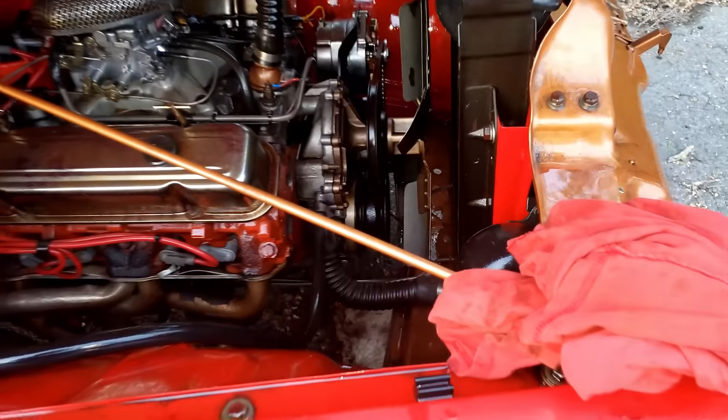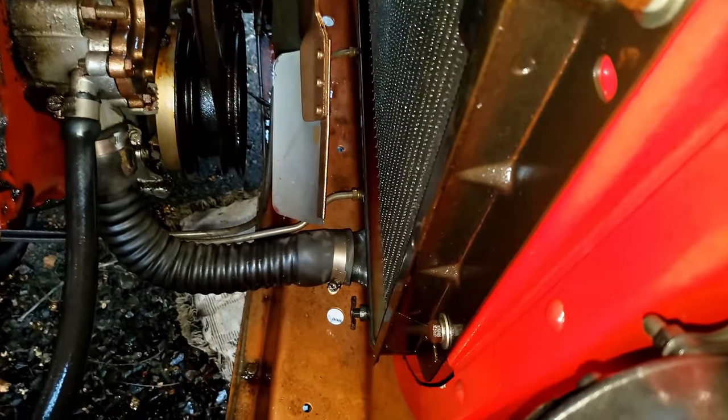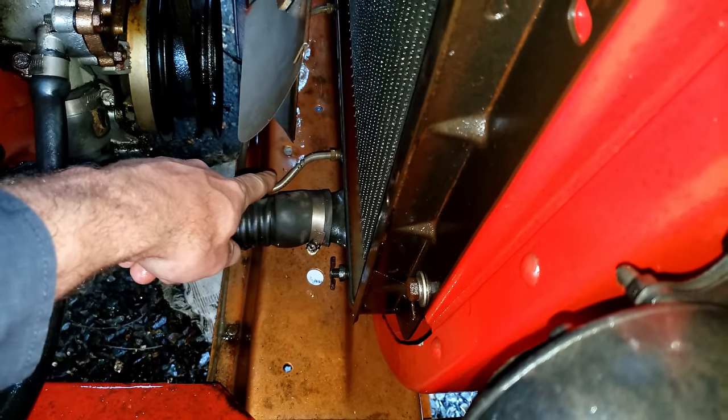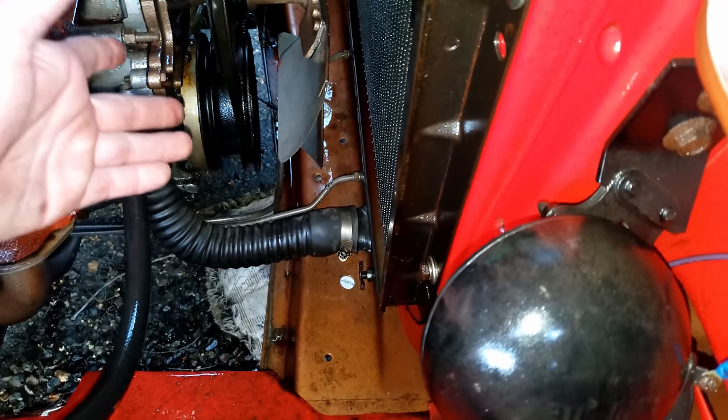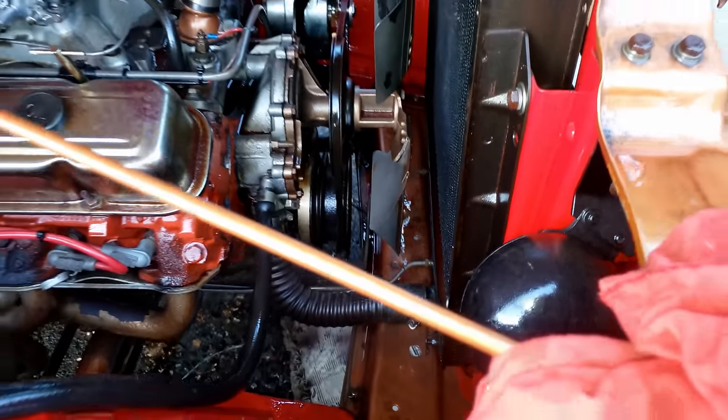Totally my fault, guys. I went over those train tracks way too fast, and I found a leak. With the smoke cleared, I can now see the rad fan chopped right through the cooler line. So this fan comes so close to that line. I wish I would have noticed that before. Then it wouldn't have been a big deal.